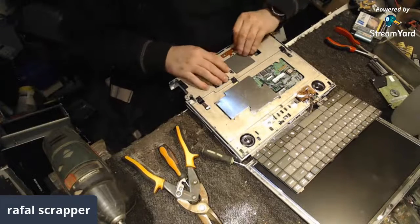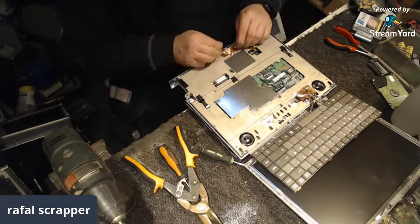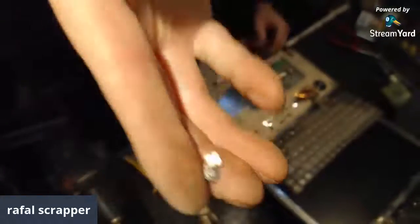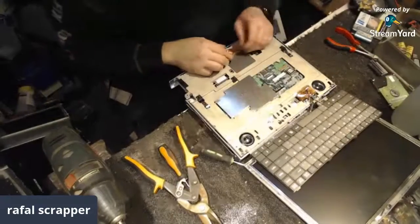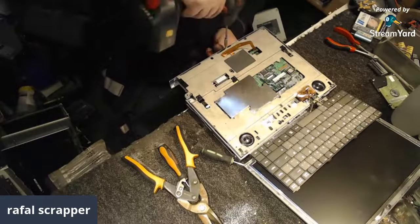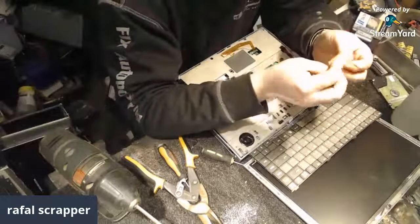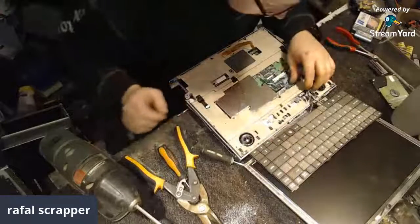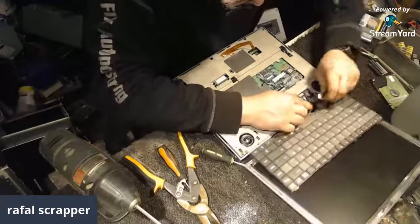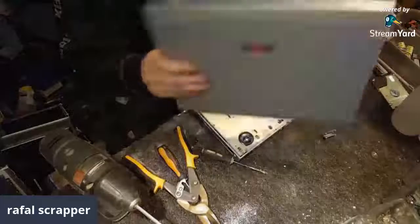Glued on. Let's unglue it. Oh, two tactile switches. Just unglue it by itself. Two tiny bits. And okay, now I need to undo some more screws. I see them. There's one. And actually there's one tiny copper tape. Sweet. To the jar. And right now I got access under that tape to the power wiring to the screen. So there we go. Screen released. Keyboard released.